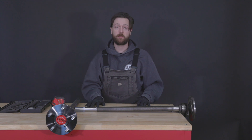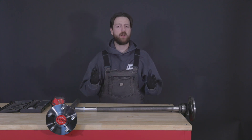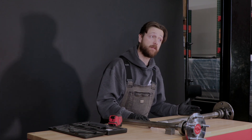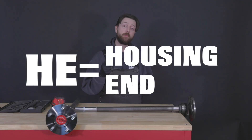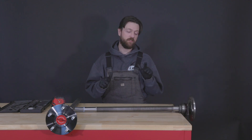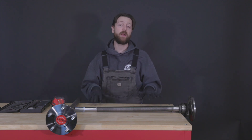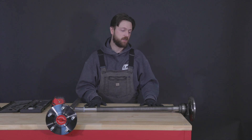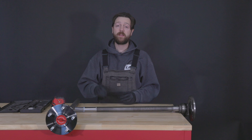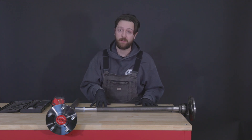Next is bearing type — there is the tapered roller bearing, which has an outer seal, and the ball bearing, which does not. Some people call it the sealed bearing, but we try to avoid that since both are sealed. If you're unsure what wheel bearing you have, look at the housing end type. On our how-to measure guide we have a chart of the different housing ends — look at the spread of the bolt patterns. The shape isn't always a reliable identifier since year, make, and model can vary. For 9-inch we have three standards; for Dana rear ends and conversions from 10- or 12-bolt setups, check the center-to-center of the bolt pattern. Knowing the housing end helps us identify any questions about brakes or bearing choice, so be sure to fill out the HE field.